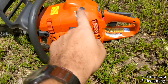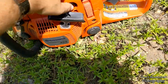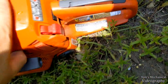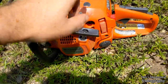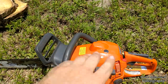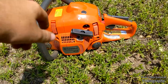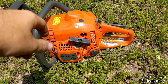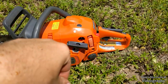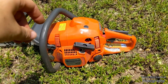I shut it off, pumped that bulb a whole pile of times, opened up the gas cap to let it vent some air — about a quarter tank in there — and yanked on it. Runs. Opened up the throttle — runs full tilt — and then dies after about five seconds. Look and the primer bulb is empty. I think she's not getting fuel. And I also broke the ignition coil during diagnostics, which was a great red herring. So I guess let's get her on the bench and see if we can find something wrong with the fuel system.